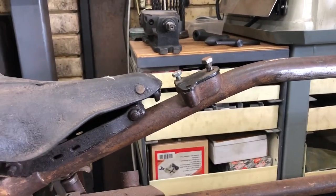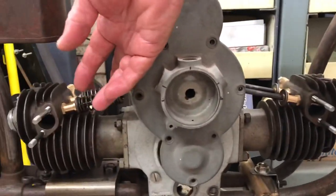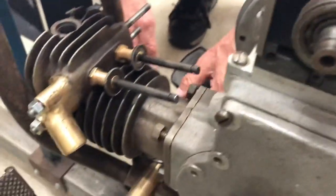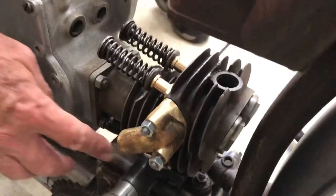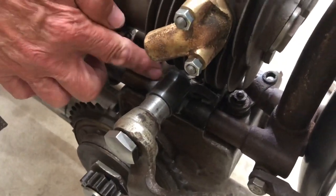So we've just been making things for the motor as we can. I've just made the valve guides up. These are Pulsar valves, so a little bit longer to cut them down. I just popped them on there just to see what they look like. So the valve guides are new now. And these castings we got from a chappie there. These are similar castings here that need to be cleaned up and tidied. We made this rod up here, and these things — the kickstart mount. That was quite a big thing. This kickstart mount here on this rod, which holds that. Nick welded that for me — did a nice job with TIG on that.